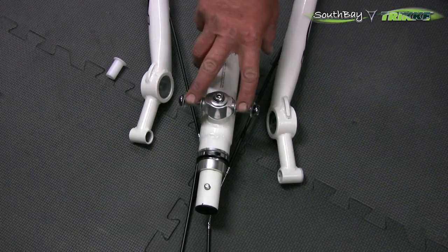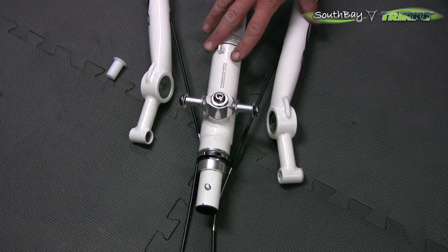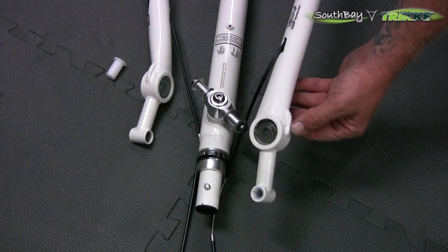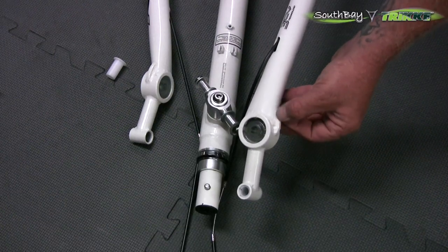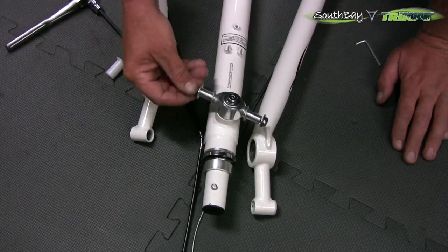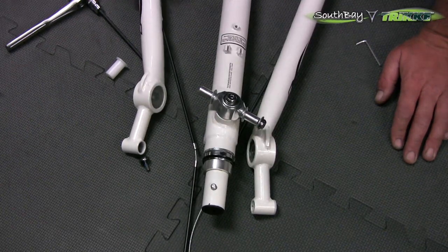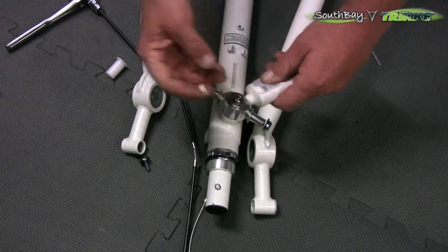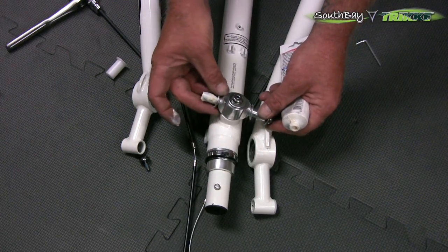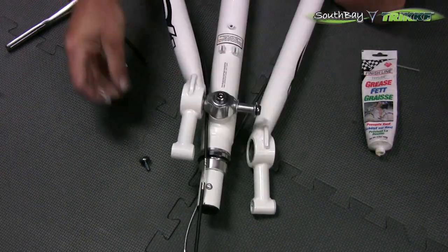So the next thing we're going to want to do here is hook up the yoke to these cambering bushings within this trailing arm. You can see I've got it laid upside down — it's just going to be a little bit easier to deal with. You can tell you're upside down by this little tab. This is a strength tab — a little piece of steel that's been added to keep some strength in here while riding. I'm going to take a little bit of white grease, put it on there, wrap it around the ear of the yoke. We've got to leave this little washer on the inside — we want some cuppage on the back side of this bushing. Work that thing on there, nice and easy.